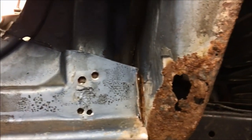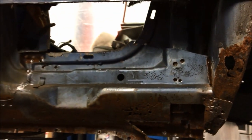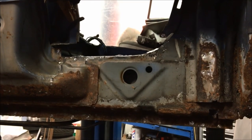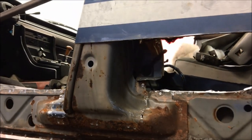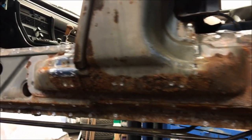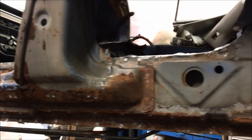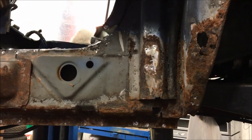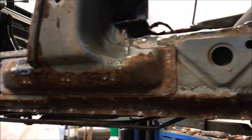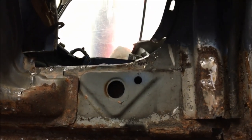Removing the outer sill will expose that very important reinforcing membrane inside. You can see the rear wing has been removed and straight away it looks like a tea bag — holes in the inner rear wheel housing and inner rear wheel arch. The membrane on this car, compared to a UK car, is actually in better condition because it's been in Italy all its life and the climate has been very kind to it. But you can see that if left for another year with that much surface corrosion, we would have serious membrane problems and the surgery would become far greater.